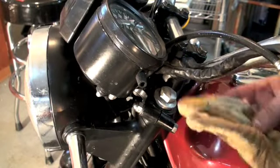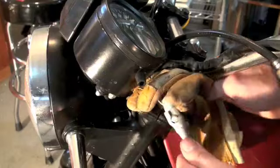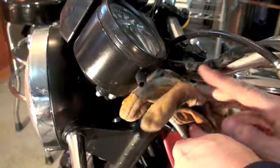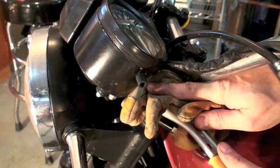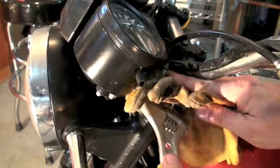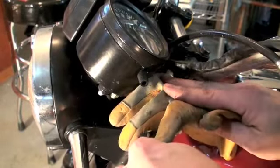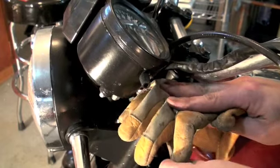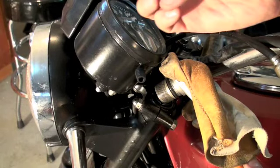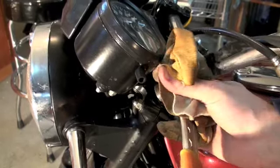What I'm going to do now is use a glove — I'm going to put my glove over the cap so that if it happens to come loose, it's not going to fly away. My glove will protect the bike and me when I reach the end of the threads on this bolt. There are probably other safer ways to do it, and if you know of one, do it that way. Oh, it just let go and nipped my finger on the pinky too. This thing lets go with a lot of force, so you want to be very careful. I'm glad I had my glove there.